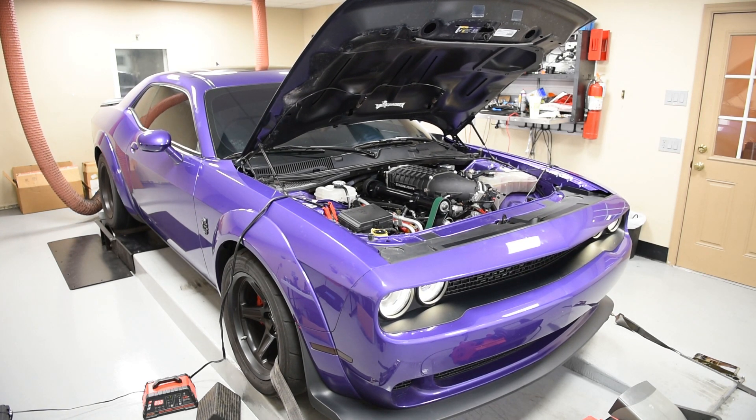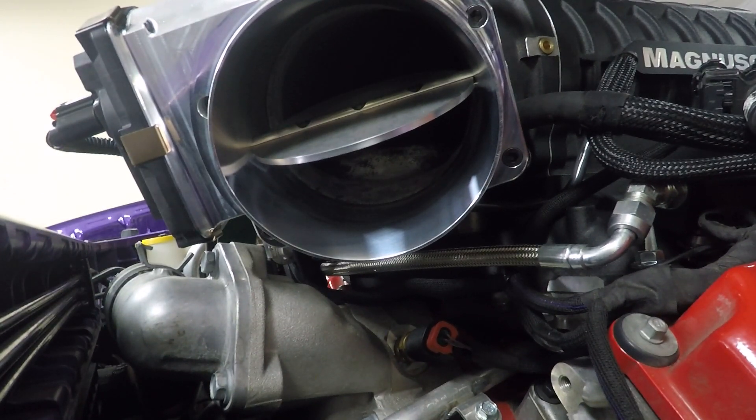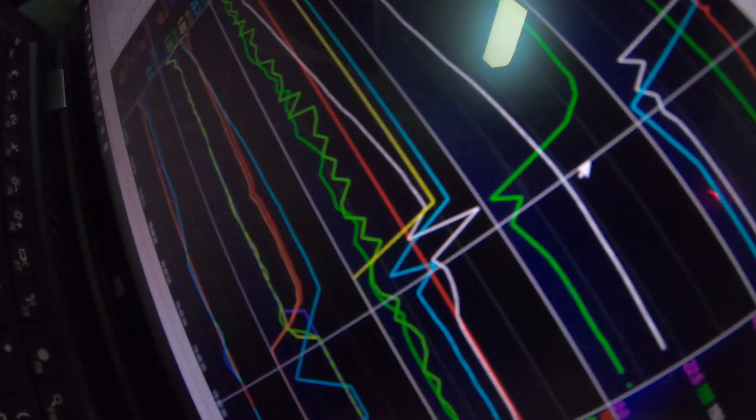Ready? Yeah, let's do it, let's see what it does. How high did we get on RPM? That was 6,400. Intake air temp started at 111, finished at 143 — so we saw about 32 degrees rise in intake air temperatures. 32 degrees of air temperature rise on a dyno pull — not bad at all. Boost started at about 20 and then rose to 24 and kind of hugged there for most of the pull. So we're at about 24 pounds of boost.